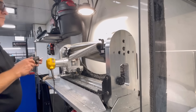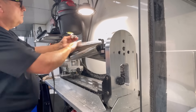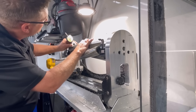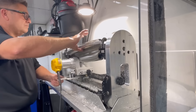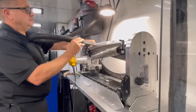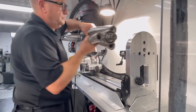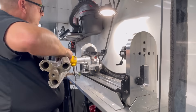I have a good idea about how much plastic should be sticking up because I've actually measured the rotor in the case with no plastic in it — we call that a metal-to-metal measurement. I know it's going to be a little bit big. I'll cut these other lobes and throw this thing back in the blower case. At the shop I don't have anybody working with me too much anymore, so I got to clean up after myself. Anyway, we're going to load this thing in the case.